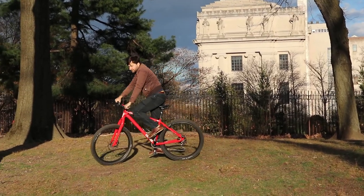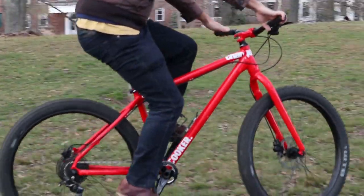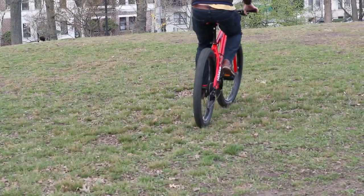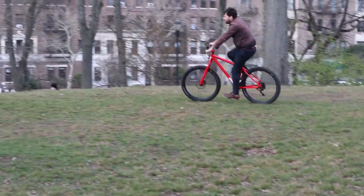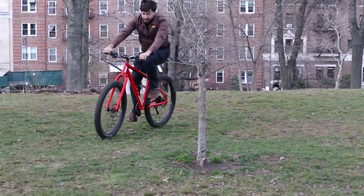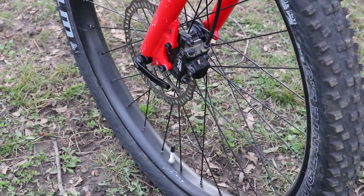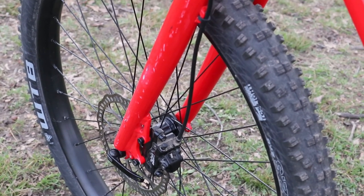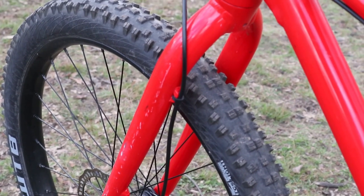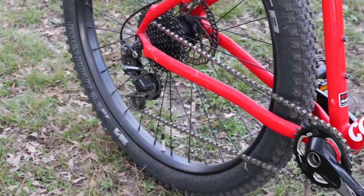All in all, the bike is super fun to ride. The geometry is very upright — the front end is considerably higher than any of my vintage mountain bikes of similar size, even with suspension. That's probably because the Cooker 1 uses the same frame dimensions as the other Cooker models which did come with front suspension. This makes for a comfortable ride, as do the thick tires which are set up tubeless. I was initially hesitant to adopt tubeless technology, but I love the extra grip and smoother ride they offer, besides the obvious added flat protection. They're also backwards compatible — if for whatever reason your tubeless setup fails, you can always put in a tube.